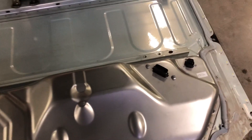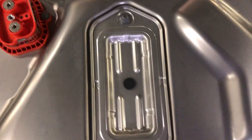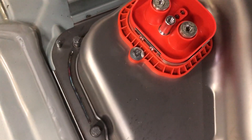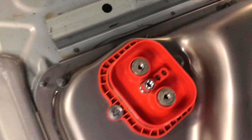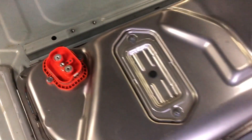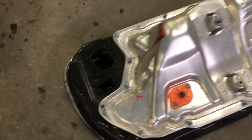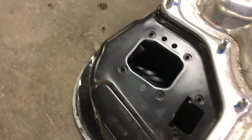Penthouse is entirely different on this one. Same fasteners around the outside. This one has an access port — presumably a pyro fuse underneath that. Interestingly, integrated into the top is the plug for the high voltage charger. This is part of the top penthouse. For comparison, I've got a Model 3 one here. This is the typical Model 3 penthouse. The charge port was actually part of the battery top.